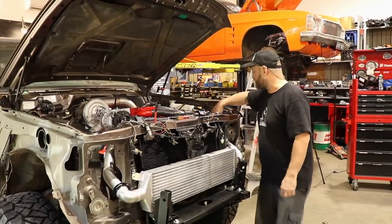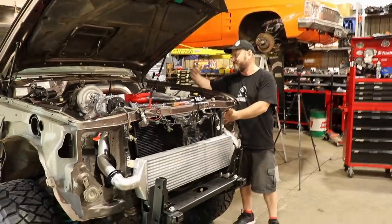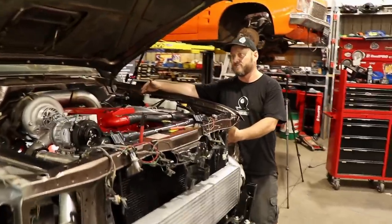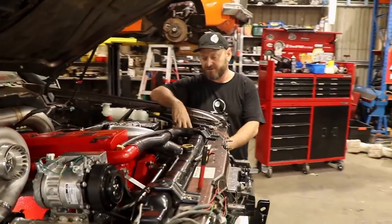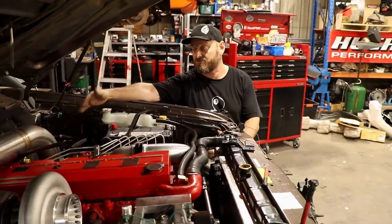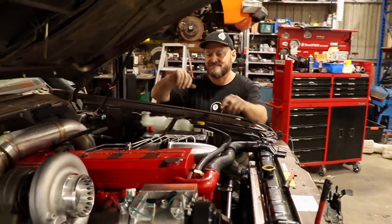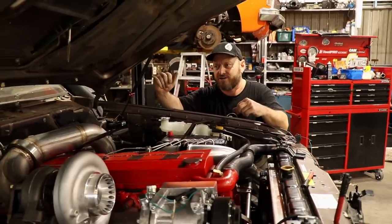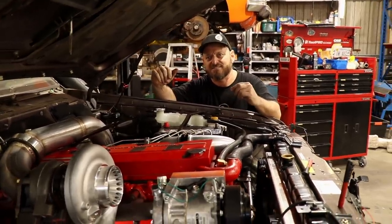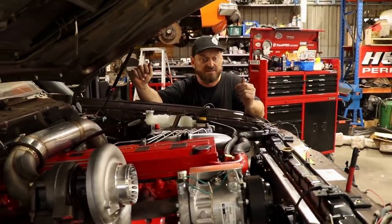We've got a bit of space left here. We've sort of been conscious to leave gaps so we can add things like we've got to put a catch can in for the breather. We need to do a brake vacuum canister as well, which originally sat around here somewhere, but it was missing on this car because it had gas. So they sacrificed brake vacuum for a terrible gas system. But we'll find another one and replace that.